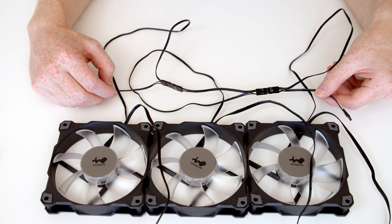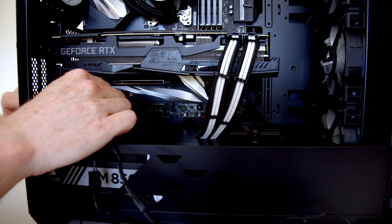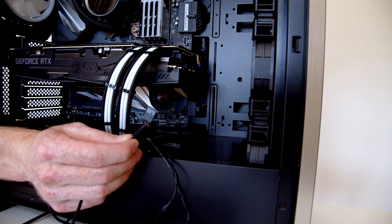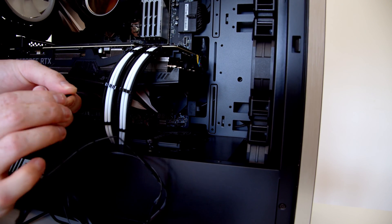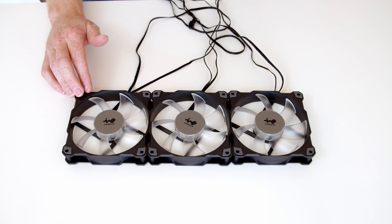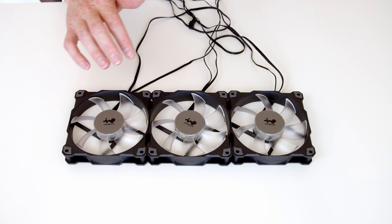Okay so that's all three of the fans connected up. I'm going to show you how to plug this into the computer. We've got one of the four pin power connectors and we're going to plug it into the chassis fan header at the bottom of this motherboard — it's a matter of lining the four pins up and then pushing it in. Next thing to connect up is the addressable RGB connector, so it's really important we line this up the right way: two pins this way, and the one pin at the end of the gap. Okay so that's all the fans connected up to the computer, and if we were to power up our PC the fans should spin and we'd be able to use our motherboard's RGB control software to adjust the RGB on the fans.